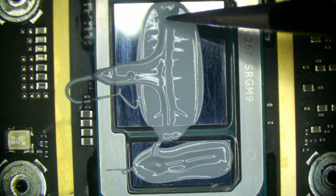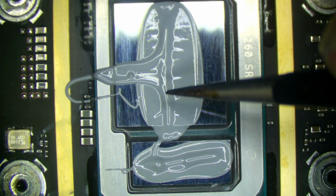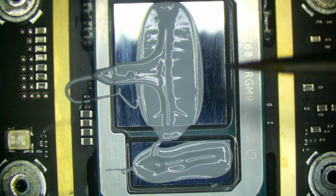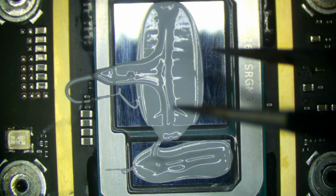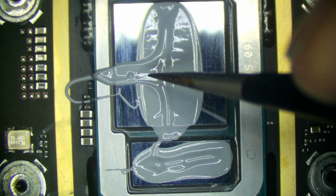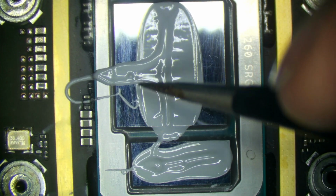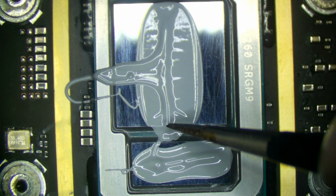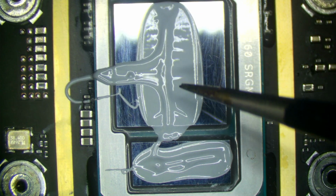And what you can see is that with the thermal paste here, we can still make out the line that we applied. So this thermal paste was never fully squished down across that CPU, and hence it did not make a seal, and it is not making thermal contact in many areas. Now, when you apply pressure on something, it is going to flow outward, and that's what happened here. So putting that heatsink on did apply some pressure to the CPU, and it did spread the thermal compound out somewhat. However, towards the edges here, it is most likely not going to be making contact. And the point of maximum contact is going to be where this thick blob is, all right? And that's pretty much going to be the only outlet the heat has on the CPU if you use a thin thermal compound like this.